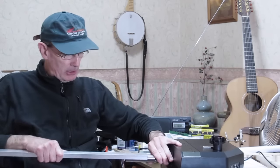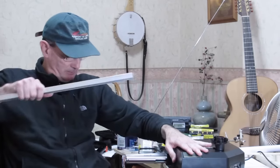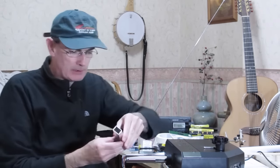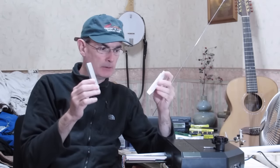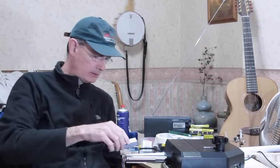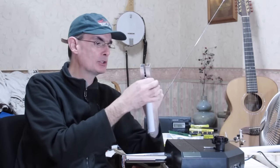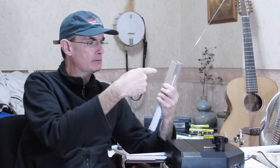And the plan is to cut, it's a very tight joint. The plan is to cut, and I've actually done this, I've cut two equal lengths of this. This is 10 centimeters long, and to join the shaft on each side. So effectively when those are pushed on, we're going to get a box section,